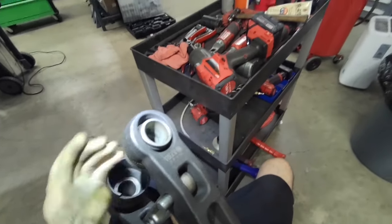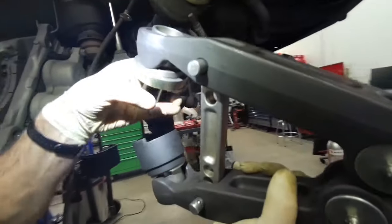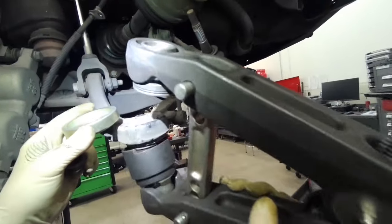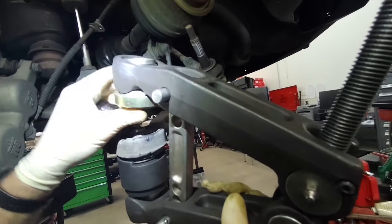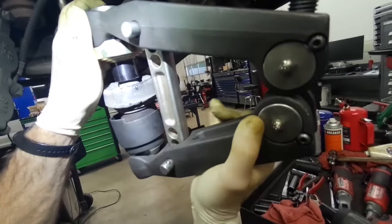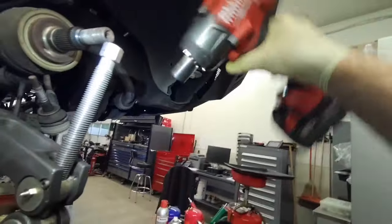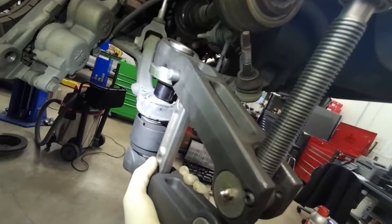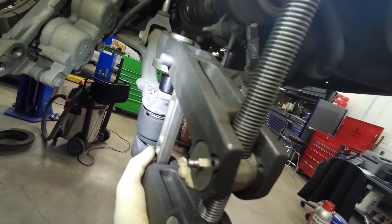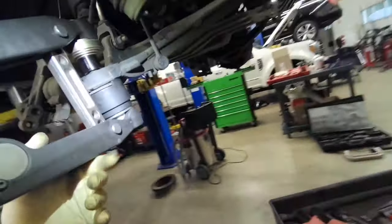Here's the high pressure version — it's really heavy. But some of these ball joints take a ton of force to get them out. What this tool does is it allows you to get two-to-one leverage versus that C-frame press style. And you don't need to grind the swedging ears on the top of this ball joint — it will just snap those right out. It'll take it out like it's nothing.